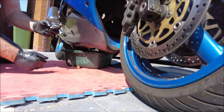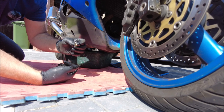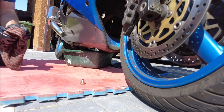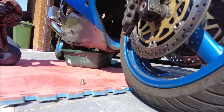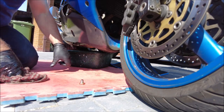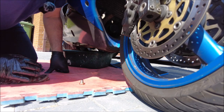Let me put that there for a minute. Not sure if you can see that but nothing on the magnet at all. I've got a new one of these to go in this time, and yeah it all looks pretty clean — nothing on there at all. The oil that came out is still golden. I don't do a lot of miles on this bike to be fair — probably well less than a thousand a year, usually around five to six hundred. But I always change the oil every year because it's cheap enough, it saves your motor, and for a bike this old the proof is in the maintenance.